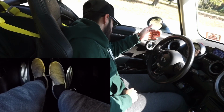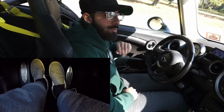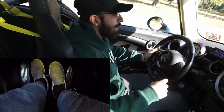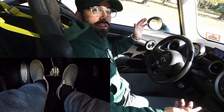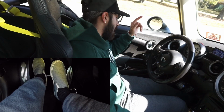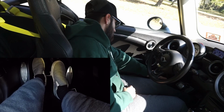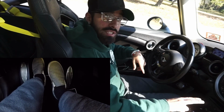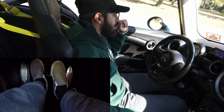So you're going to let it out just a little bit, an inch or two before your catch point. So when it's time to get going, you're already right there and you're rolling forward. I'm going to do that one more time. We're going to roll back a little bit onto the hill. My foot's on the clutch and my foot's on the brake. I'm in first gear. You let out the clutch just a little bit. Right there, just a little bit.